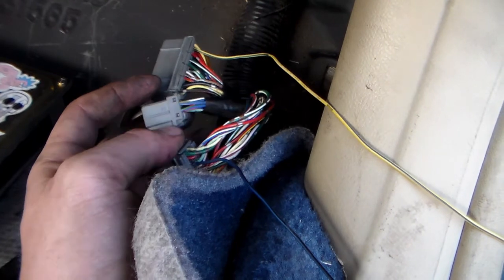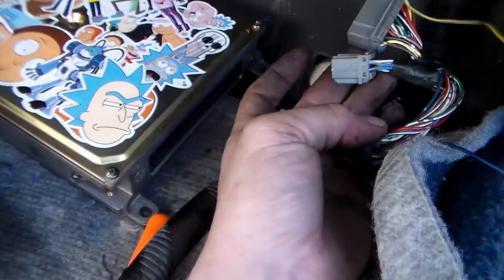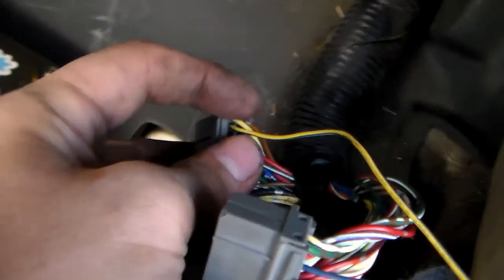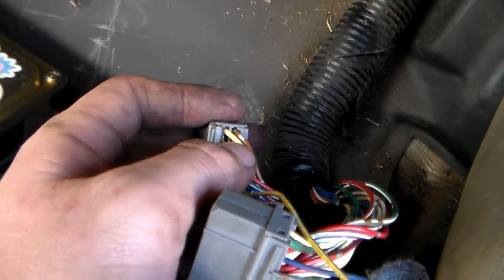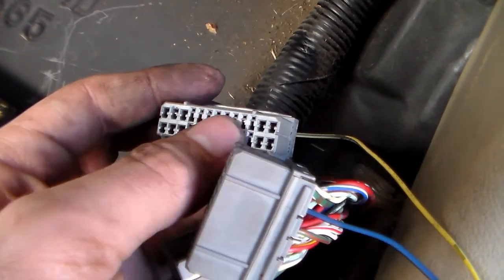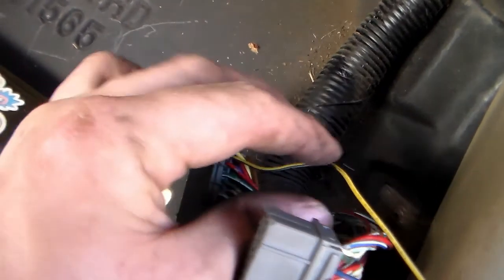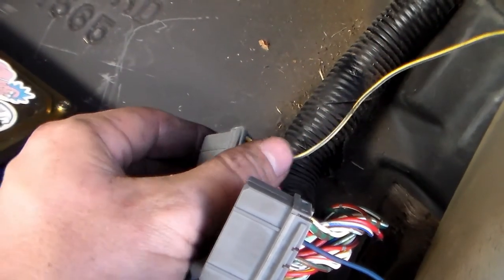I had a spare 2000 Honda Civic harness laying around, so I just de-pinned a couple wires. On your connectors that go to your ECU, there are three of those. Two of those will have missing spots for these wires if you have a non-VTEC LX. I'll recognize this connector by having a solid brown wire on one end. It's got six big pins on one side, four big pins on the other, and then a bunch of little ones. Position A4 is going to be the VTEC solenoid valve wire. I used a yellow and blue stripe wire to connect that one.